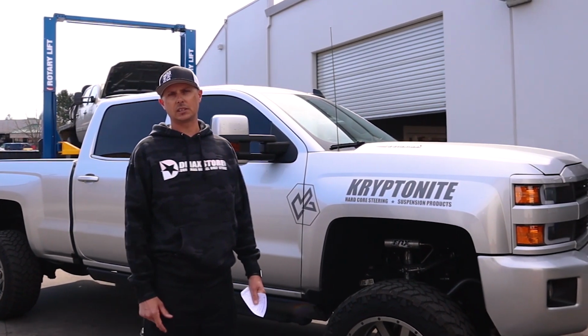The CP3 and CP4 both have a vacuum system on them, so they're actually sucking the fuel up from the factory. Now you're going to take that vacuum system and put a small amount of pressure on it. That helps take the load off of the injection pump, to give you better longevity, more miles and time out of it. Getting better, clean fuel to the fuel injectors, like I mentioned, is also going to help with economy, help reduce some of the emissions coming out of your exhaust, and give a little bit better throttle response also. So there's a lot of good things about these lift pumps.